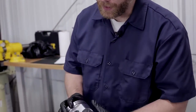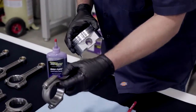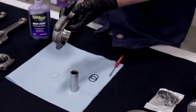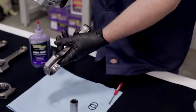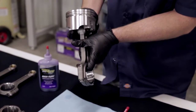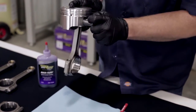We've got our two spiral locks on the back side. Remember, we've got an X on our connecting rod that needs to be on the same side as the top of the eyebrow, so it needs to go in like this. We're going to hold everything there, take our wrist pin, and get it started in.